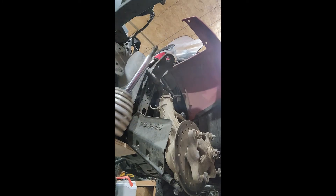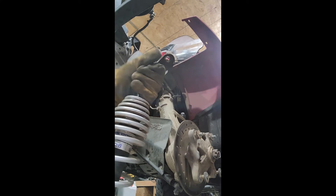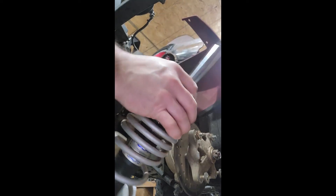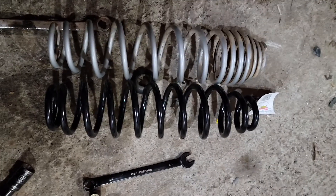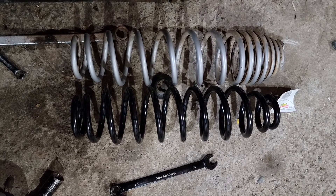With the leather glove on, I was able to hold it tight enough and use the impact gun to spin off the top nut. Now we have the old spring assembly. You can see the rubber stopper up in the top — we just need to make sure we transfer that into the new spring. Take it apart and pop that out.